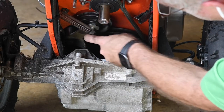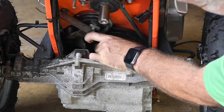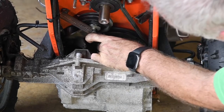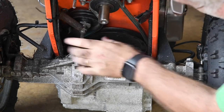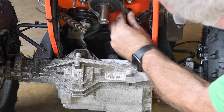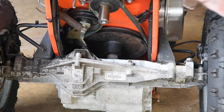That's why I advocate for the one-inch longer belt. It's still tight enough when you grip the handle — the pulley still has room to come in — and then when you release it, it's super loose. Seems pretty straightforward. I don't know why people at DR Power have so much trouble with it.